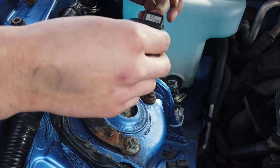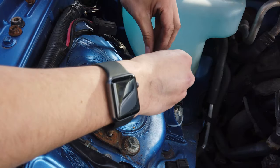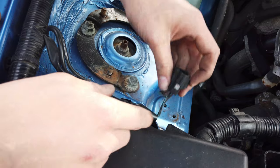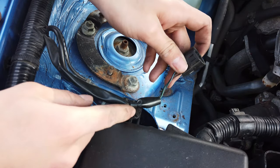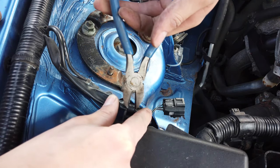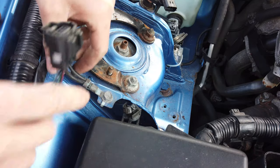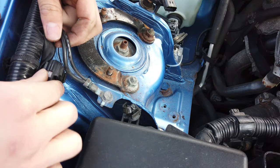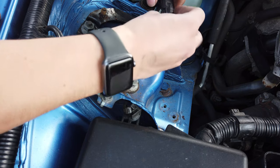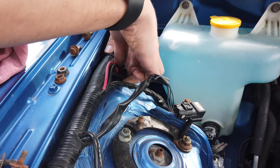Now we're going to put the ambient air temperature sensor back in. We have this bolt, so we're going to slide that over, get the little nut for it, and put that on. This is the connector for it — it's held in by a zip tie clip, so the easiest way to undo that is just snip it. Now we can run this through these wires, just underneath and right over to the sensor. The connector for the air pump can just tuck away somewhere — out of sight, out of mind.